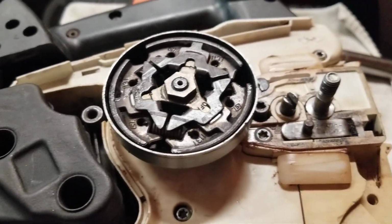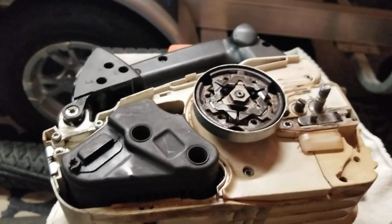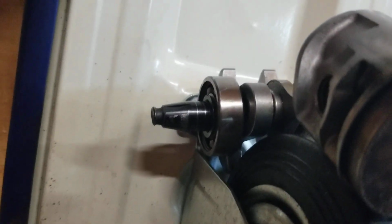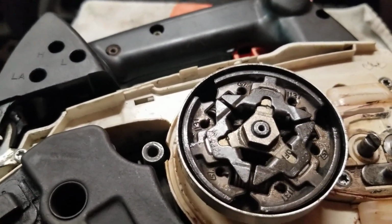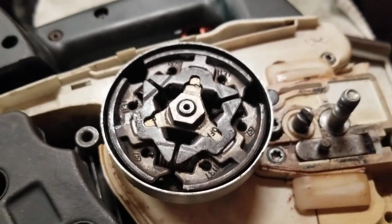You have it. Nothing really to it. If you don't have the tool, tighten them down. You can feel when it stops. Don't go any more than that because you will snap it off and you'll end up with an issue like this one where they snapped off the flywheel nut, and you'll get pissed. If you jam it down there too tight and you go to take it back off, that will snap off. Trust me. I've done a few myself when I first started doing this.